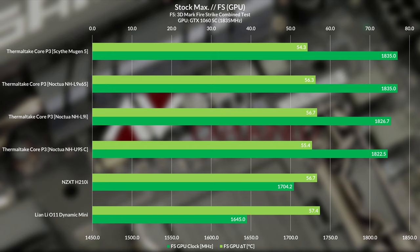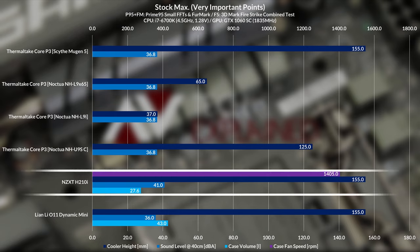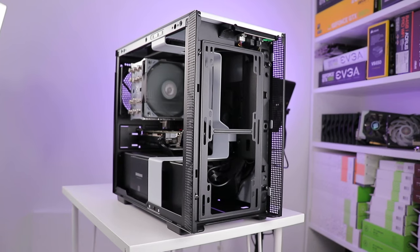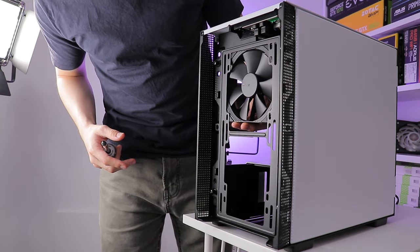Before moving on to changing up the fan setup, it's worth noting some important points — such as the comparative case sizes, the max fan speeds the stock fans were running at throughout stock testing, which was 1400 RPM in the H210i, and the noise level of the system which was 41 decibels at full speed. Long term, that isn't very comfortable, so I'd opt for lower fan speeds which would result in higher temperatures, or maybe a different setup. The most intuitive change to better optimize this case would be to add some intake fans to the front. The following testing is noise-normalized — setting the case fan speeds to emit a certain noise output of 37.5 dBA at 40 centimeters away from the case at a 45 degree angle from the front.